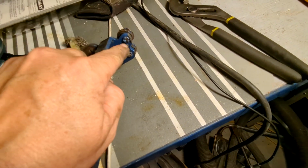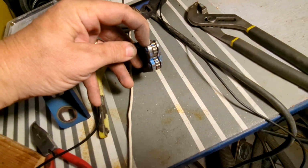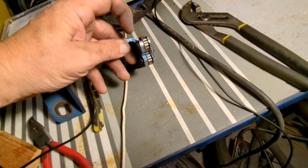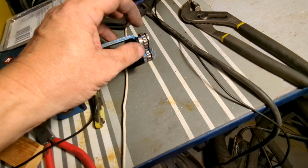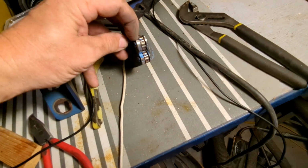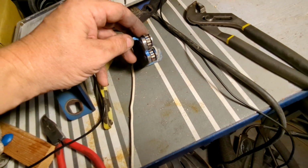So the only fix that I see for this is drilling these out. It'd have to be an unthreaded shaft that went through from the top to the exact, basically, bottom of this wheel. And then a threaded shaft that came out here. And then I guess you could weld the nut on. But I don't have a machine shop, so the odds of me finding something that was perfect to fit this potentially even wallowed out, not even round anymore hole, unthreaded, and then a threaded that starts exactly at the end of this. You got to have that machine. The odds of finding that are zero. I'm not going to go through my screw bin and find nothing. You got to machine that.